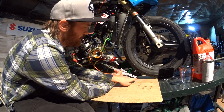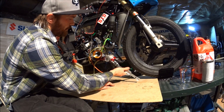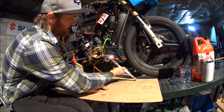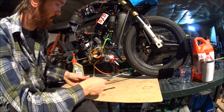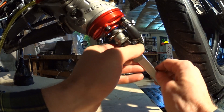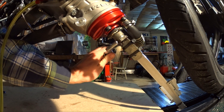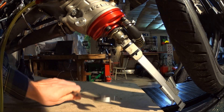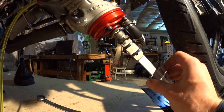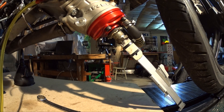Why I did this is because with the clearance under my engine in the upside-down position, I'm not able to rotate the caliper without lifting the front wheel off the ground. But now that I've cut off the measuring sticky-out parts, I can barely rotate it into the hole. So I'll show you how I use this tool. The first thing I do is thread the tool into the spark plug hole, then tighten it just enough so that it's easy for me to read off the tool. Then I push it down into the bore.